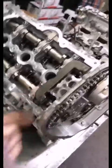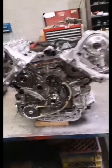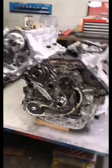Now we take off our cam plates, we pull our crank plug out, and then we spin it around. Seriously, if every engine was this easy to time, my job would be a lot easier.